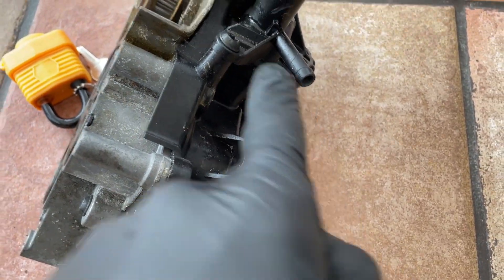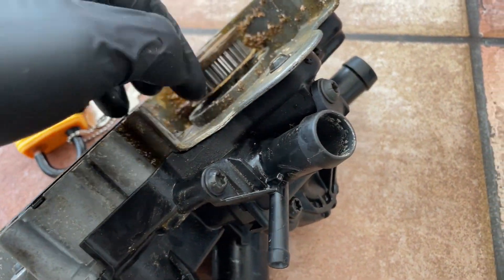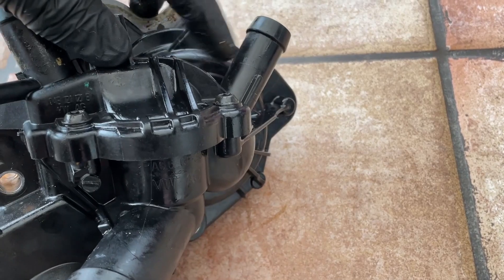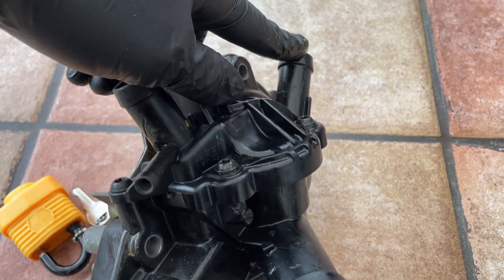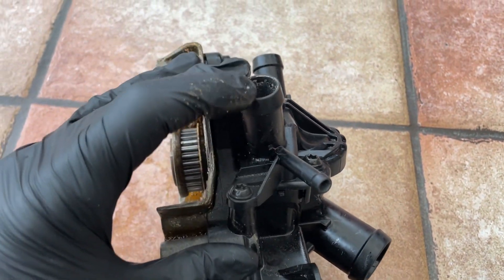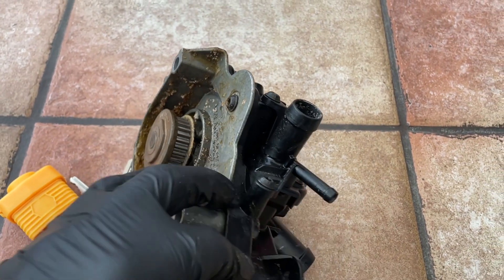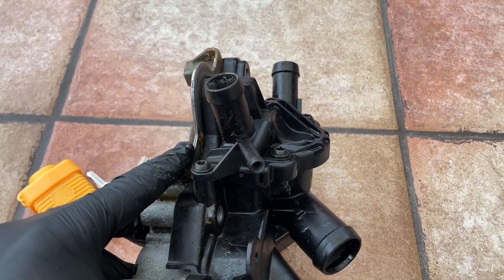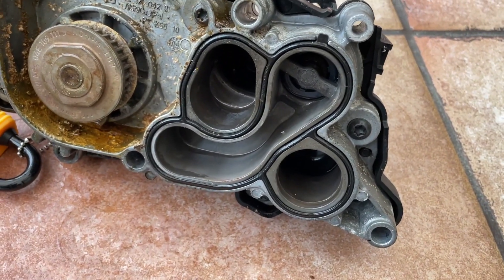The cool feed comes into here and must be driven by the impeller. You can make out there's a little turbine in there, which forces the coolant out of the various pipes. I believe one of these pipes goes off to the heater matrix in the dash to give your interior some heat. There's also a very small pipe going off to the charge cooler, which is liquid cooled by the radiator. Then there are feeds and returns for inside the engine block itself.